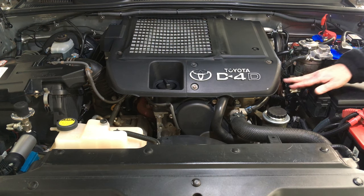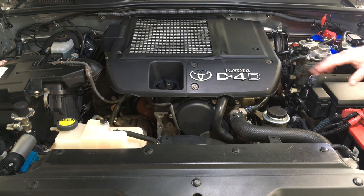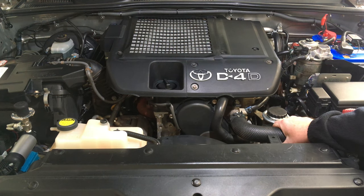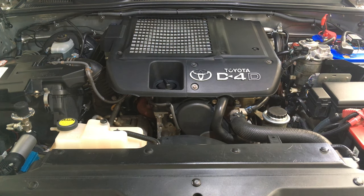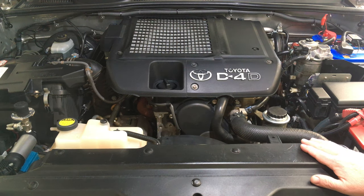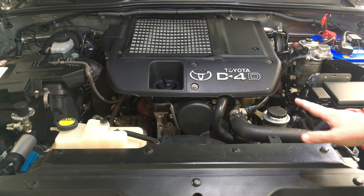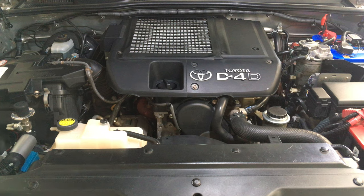Hoses — you've got your clips and clamps, make sure the clamps are right. For other cars, if you've got an old Commodore or an EA Falcon, I suggest you replace the hoses fairly often — every hundred thousand k's. The materials used and the coolants used — it's this stuff, what we're talking about here, is quality. It helps make things last. This is what you're paying for when you pay a little bit extra for Toyota.